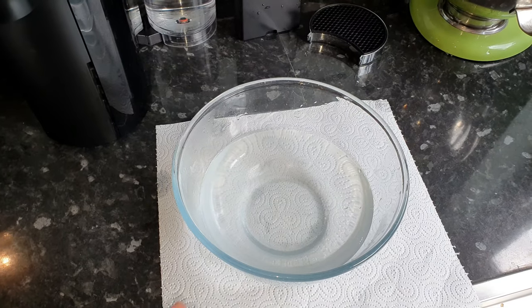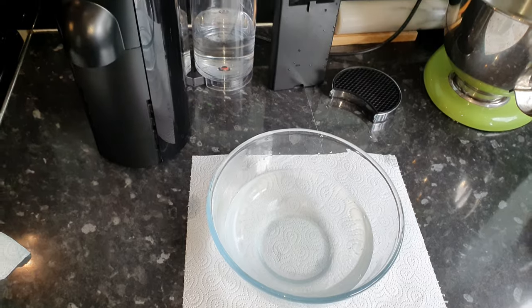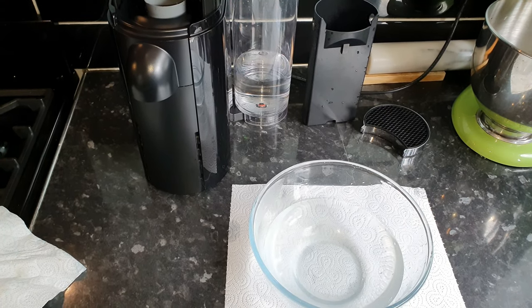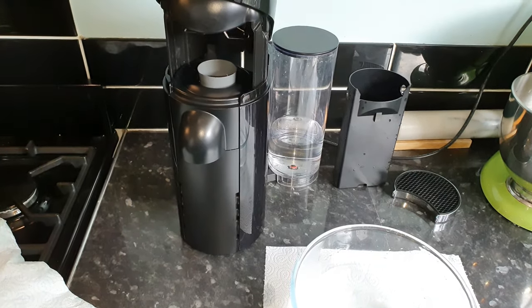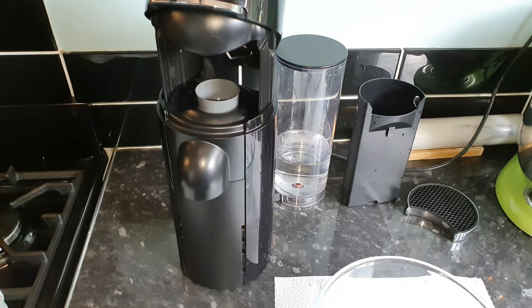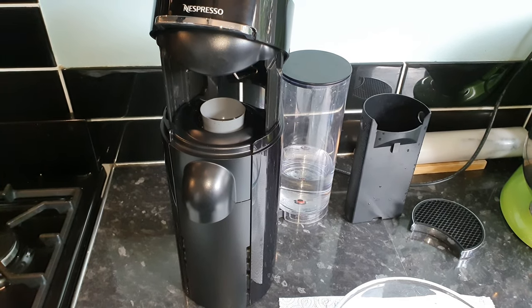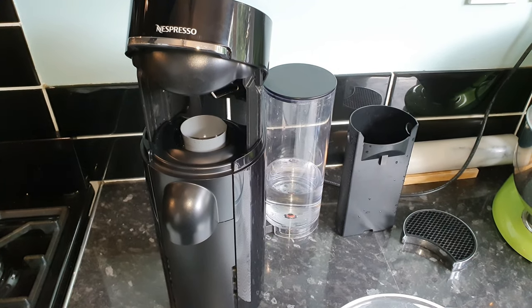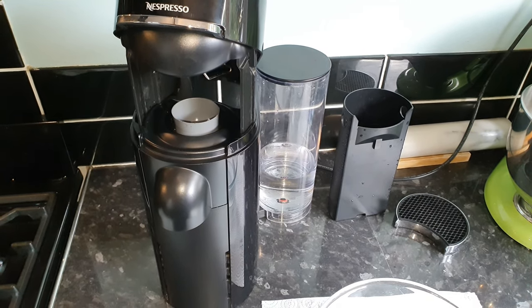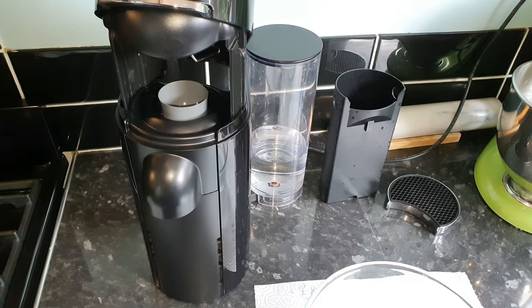That's the fourth cycle and now you can see the water is almost perfectly clear. I consider that to now be a clean machine and I'm ready to put it back to use. So if you start getting nasty horrible black stuff leaking out the back of your machine, or it's not making coffee as it normally would, or your mugs are overflowing, my advice is to give it a really really good clean — get in there with a toothbrush (that wasn't actually my wife's toothbrush, I was only joking!) — let that cycle run through three to four times and you'll have a nice clean machine that will last as long as you keep looking after it. I hope you've enjoyed this video and I look forward to the next one which will be about the Nespresso Pixie. See you soon, take care, bye!